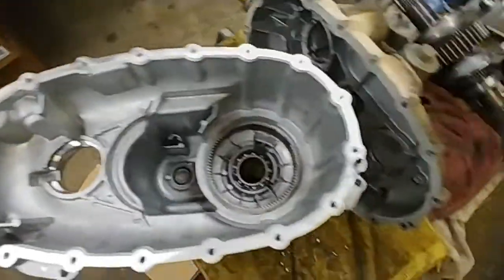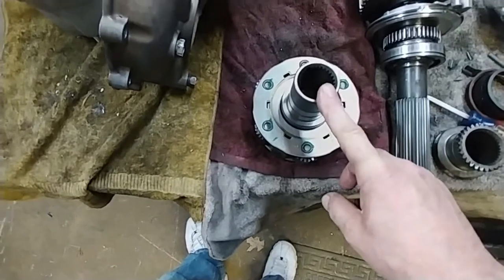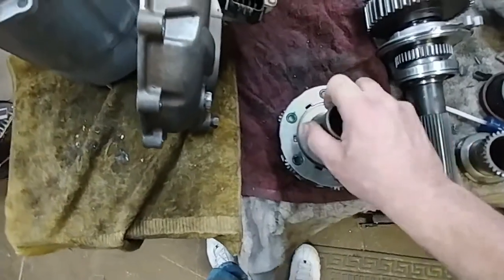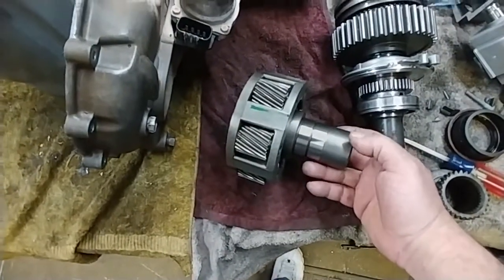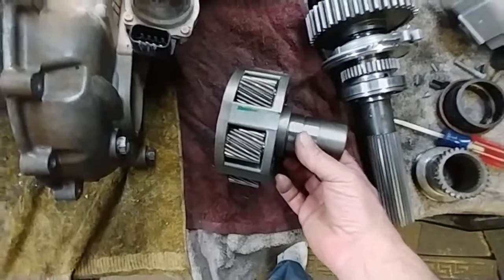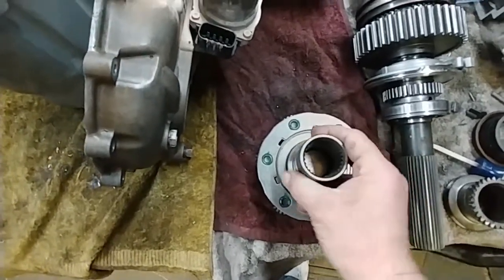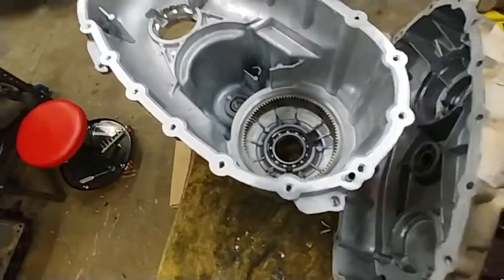Okay. And also, this input shaft is not listed on an MW7, which is an Allison transmission. This is an MYD, I believe, transmission, which is GM's transmission. It's the gasser transmission. But the shaft and all the parts to it, this race for the bearing, all fit this new case. So again, this shaft here is actually for an NQH case, like this case, but it's not for the Allison transmission, although it does match up perfectly. I measured the splines, I counted the splines, and I also put it on the transmission itself to make sure that it fits, and it does. It's a perfect fit, it's a perfect match. So they say it can be done according to the TSB. And obviously, with all the parts that I have now, it can be done.